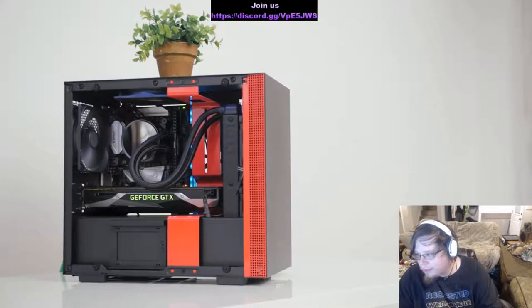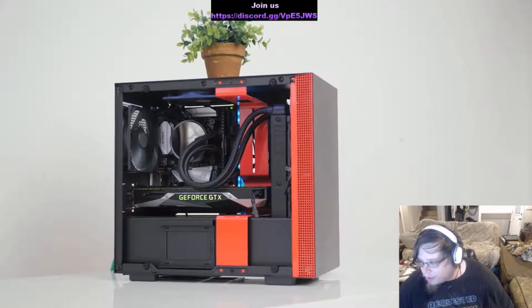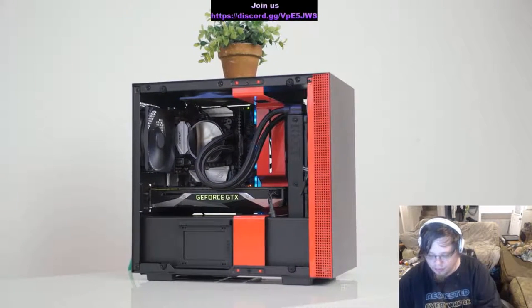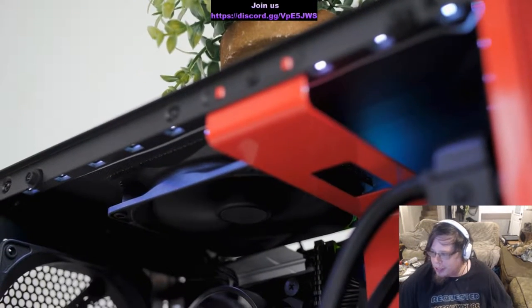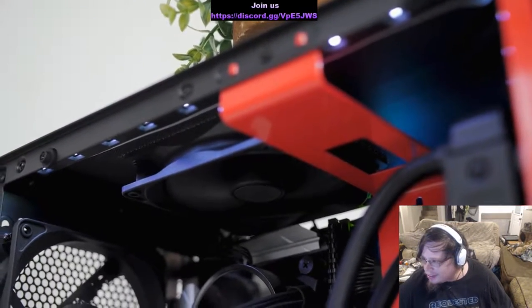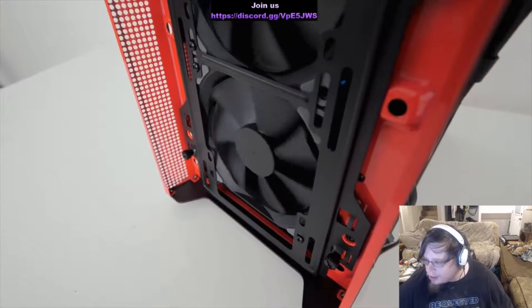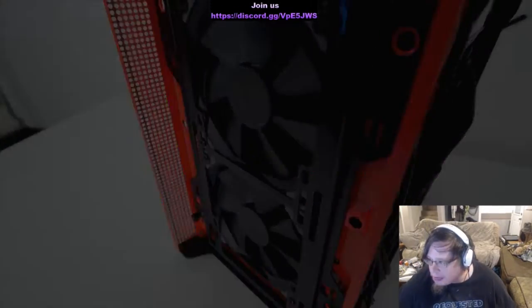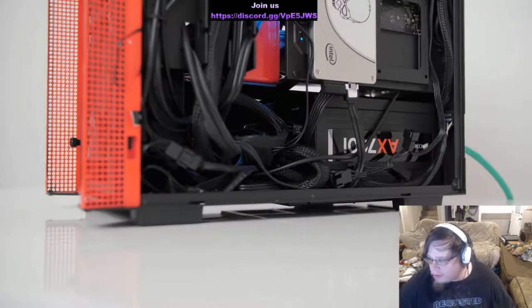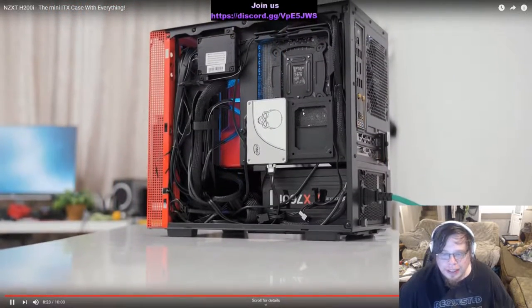So the entire build process was easy. I'm satisfied with the interior. It doesn't appear too large for the hardware. SFX-only support would make the shroud even smaller. The built-in LED strip at the top is more for the back of the case and gives off nice lighting. And you definitely need to have a radiator at the front, otherwise the case is not fully utilized. Cable guidance at the back is not tricky at all with these plastic channels and the large pocket in front and on the side of the power supply.